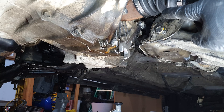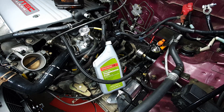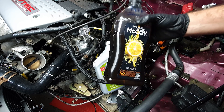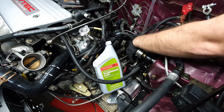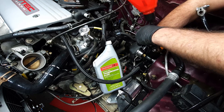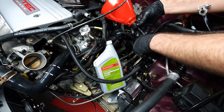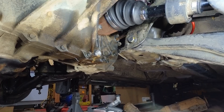The fill bung and the overflow bung is 17. Some Honda MTF liquid gold, and a whole bottle of MTF that was out of my S2000 — I ran some MTF in it for 20 kilometers just to see if new fluid would solve a noise problem I was having. It did not, but you can see those videos on the channel. The S2000 gearbox cooked. Let's put some fluid through this gearbox and just let that run through, then do up that bung and fill it up properly.